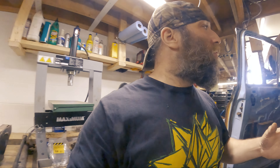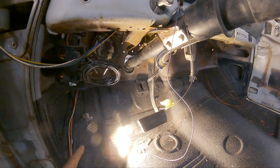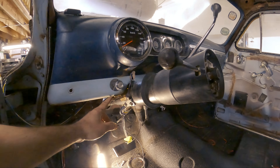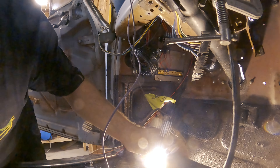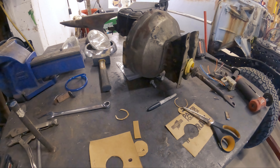This has become a lot more intense than I thought it would. It's making me realize maybe I put the cart before the horse — I should have installed the brake lever prior to doing the wiring. The challenge is I'm taking two cars and trying to combine them without buying a bunch of aftermarket parts, just making use of what I've got. The spaces are obviously different — what was in the truck is going to be different from the car in terms of dimensions. What I've realized is that I mounted the steering column too far back, so by moving it a little bit forward I'm going to give the brake the throw it needs.